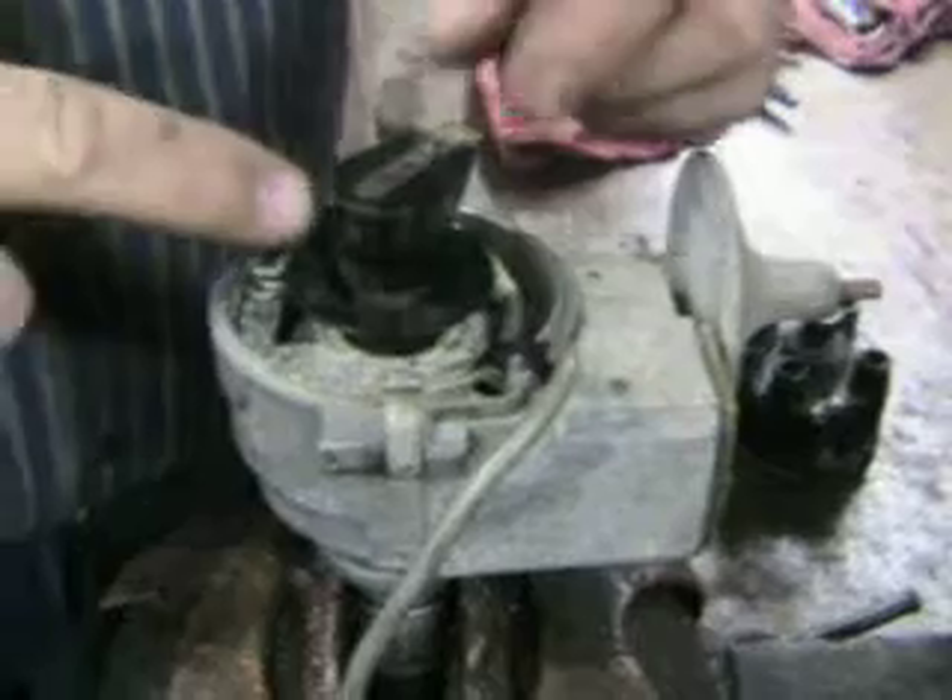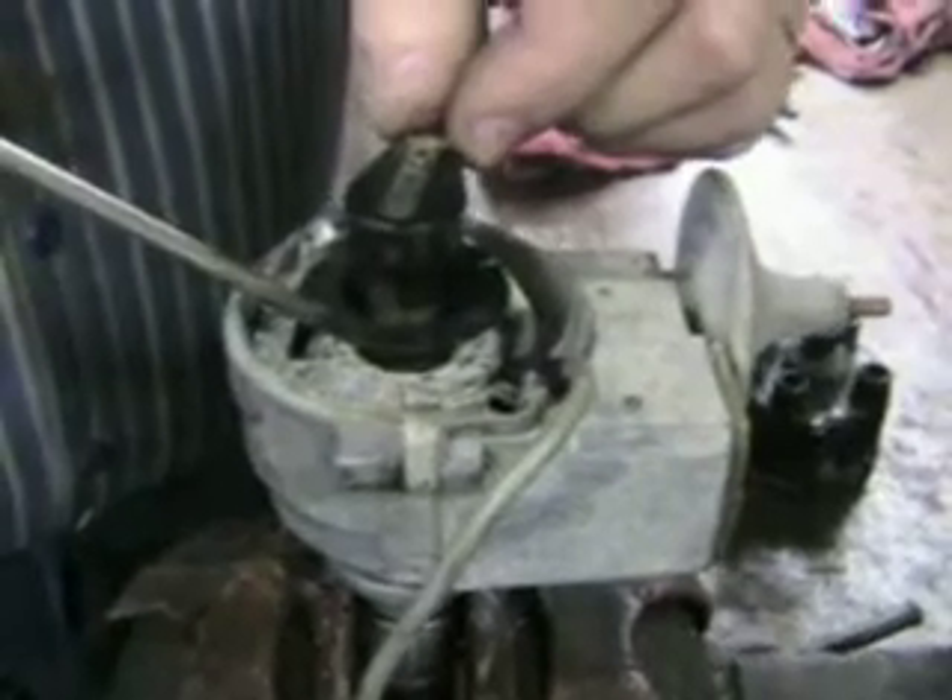That's about as close as we can get. We're tightened up and now our disc doesn't hit the eye, and every time it comes around and finds a slot right in the center of the eye, we are pointed at one of the discharge points on the cap.